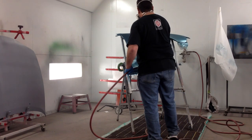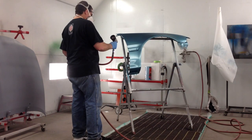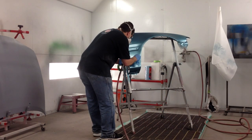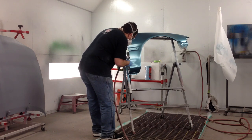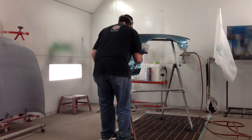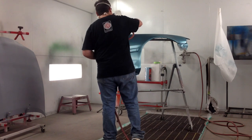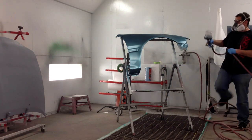Getting the next coat on, going out a little bit further with this blend. This is some old footage by the way — I lost it for a long time and just found it, so I'm going to go ahead and finish this video series. I had some more stuff — probably some dirt or lint — coming out, and notice I'm using the air to blow it off as I'm brushing it, so that it blows it away from the fender. Now I'm going to spot those spots in just lightly, and now I'm going to readjust the gun. This is a tight coat that you need to do with waterborne: turn the pattern wide open, turn the pressure down to about half, hold the gun about 12 inches away, go real fast, and overlap real tight.